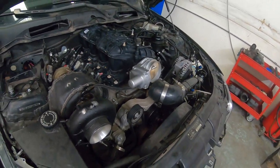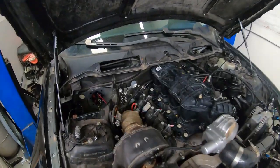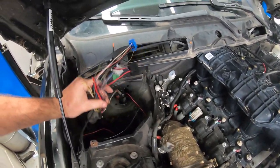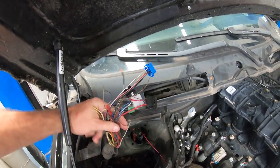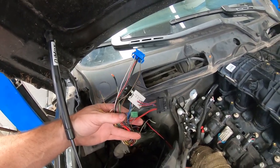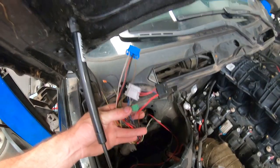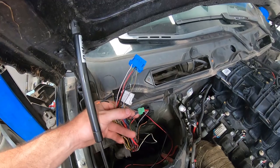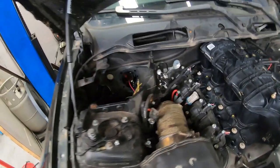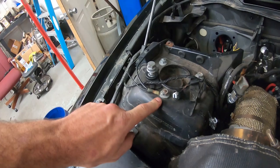As shown in the other videos, you basically rip out the entire BMW harness, and the only thing left is what's in the DME box. Mine's already been cut apart a little, but this is the only harness remaining. There are a few different colored connectors, and depending on the year and model BMW seems to change a lot of this. We'll go through these one at a time and show you where to find the key-on ignition power, drive-by-wire, fan control, reverse lights, and everything needed to get the car running, plus constant power and ground.